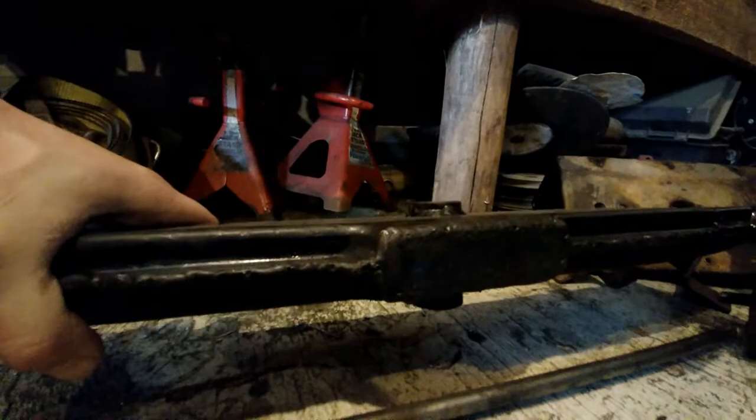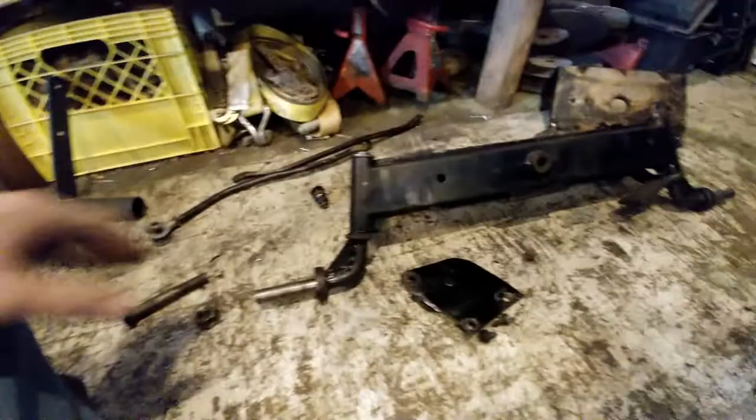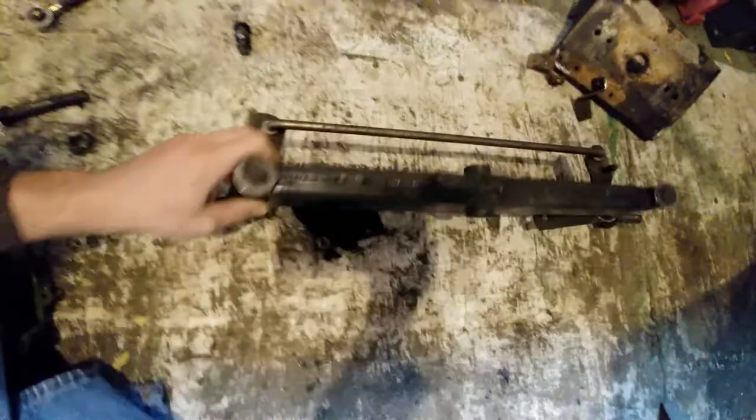There was a plate coming off, so I cut it off and put a plate to plug it so no water can get in. These steering linkages here are better — they're way more than a quarter inch thick, not eighth inch. And on the back is a link bar. It links the two together so when you steer one way, it steers both of them at the same time. So you can't really come out of sync or out of alignment unless this bar breaks or bends or something. But in all my tractors, it's hard to do.